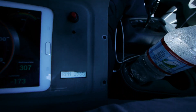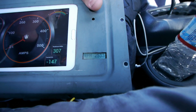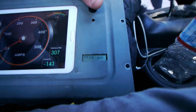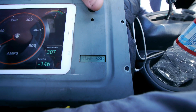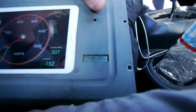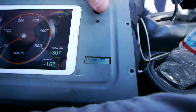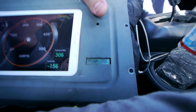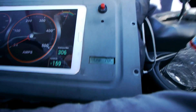I'm going to keep an eye on the motor — 120 amps, 123 volts. The motor temperature is at 68 degrees Celsius, which is a little bit hot. I don't know if my cooling system is actually flowing, but I've got to keep an eye on that. If it reaches 80 degrees, we've got to stop the charging. Actually that was the motor — the controller is at 55°C. My cooling system is definitely working if it's at 55. At 2,600 RPMs, I think that's why the motor temperature is 70.